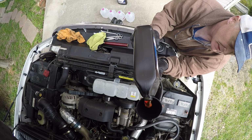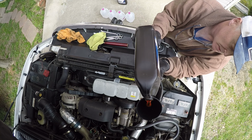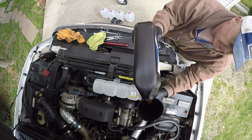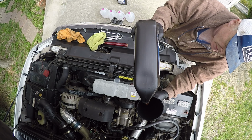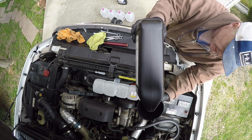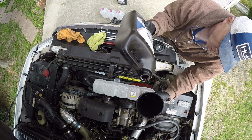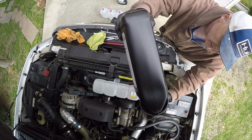You can put an additive, an SCA. We're going to put in 4 gallons of concentrated antifreeze. Crank the engine. And then once everything pulls down, cut the heater on high. Once everything cools down, we're gonna fill up with 4 more gallons of distilled water to make it a 50-50 mix.